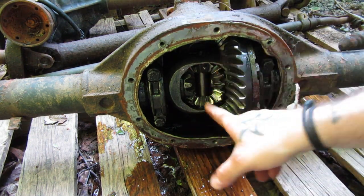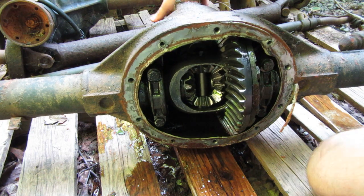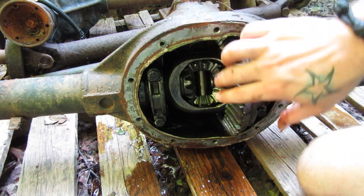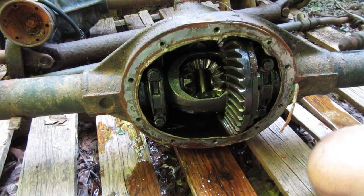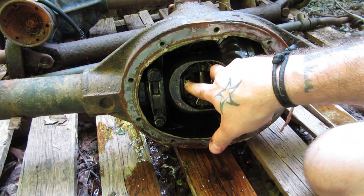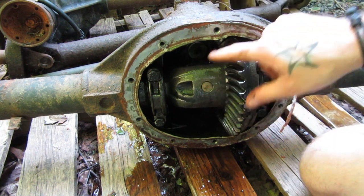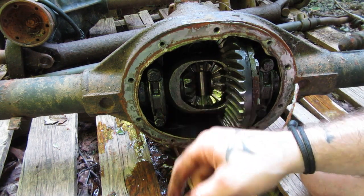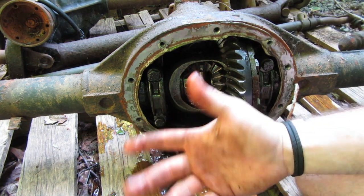You can put a lunchbox locker in with your vehicle in the driveway up on jack stands and your carrier still in your differential. What you do is — see all these spider gears? The power comes in through your pinion gear attached to your yoke and your drive shaft, gets transferred to this ring gear, which then acts upon these various spider gears. These top two are held in by this cross pin and are attached to your carrier. The side two are attached to your axles — they're splined and your axles go into them.